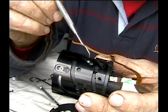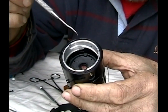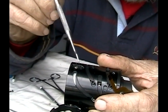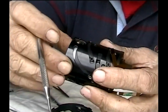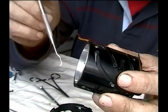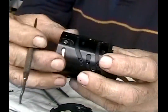Once they're all in, maybe some tape on them would help hold them in place. Then this piece has to go in — it has these three slides that go up and down as it rotates, and this couples to a floating optic that's in the next section: the front section of the lens. So I'll back down to go over those so you can understand.